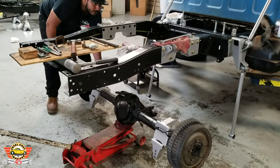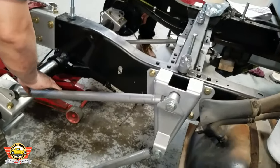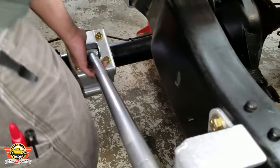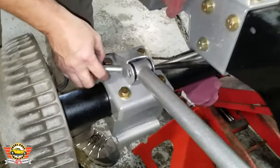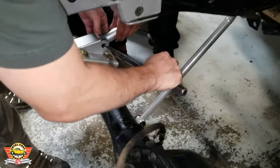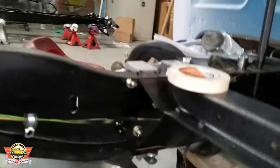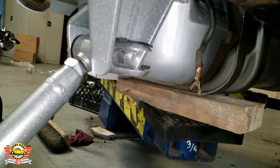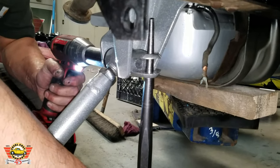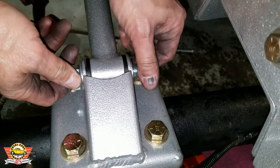Go ahead and put the rear in — slide it up underneath the frame and use a jack to bring it up into place. It'll take a little bit of finagling; use a punch to help align and then get the bolts through. We typically like to do the tops first — driver and passenger — then jack it up and get the bottom into position. On the driver's side, the lower link bar mount is where we connect the track bar mount, which allows us to attach a half-inch bolt for the track bar. It will go crosswise to the rear axle bracket on the lower as well.